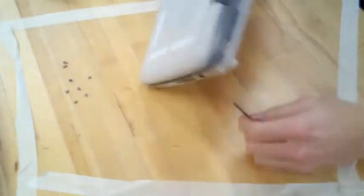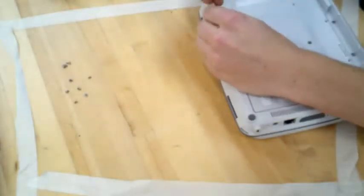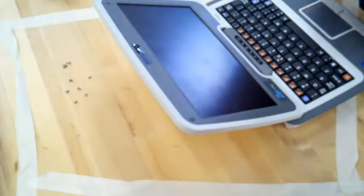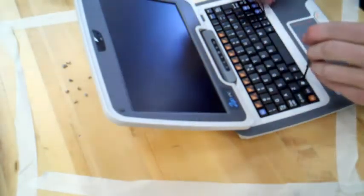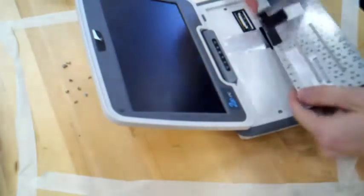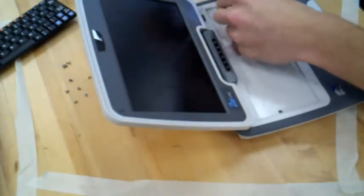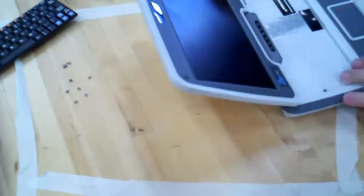You have to get those out too. To get the keyboard out, there are two clips in those two spots where I have the two small screwdrivers. I tried to press both clips in at the same time and then pry it up a little bit — then it's caught at the top and you just have to pull it out there too. When I pulled the keyboard out this time, it actually pulled the ribbon cable right out of the slot. It didn't the first time, so what you have to do is take that white part and pull it out vertically. You can see the two screw holes on the right and left where the keyboard used to be.